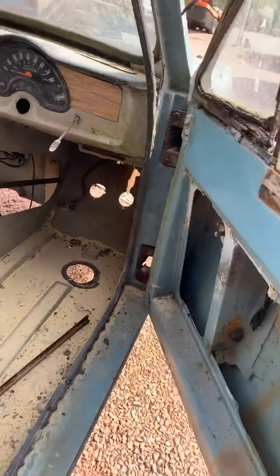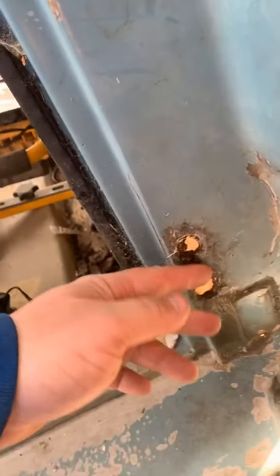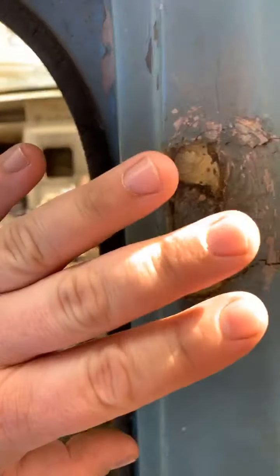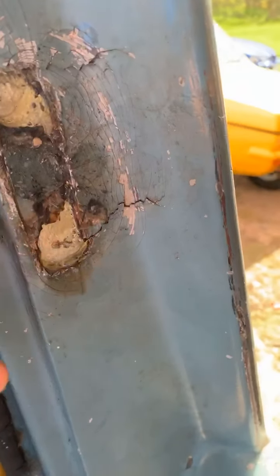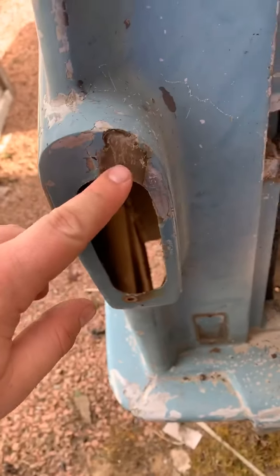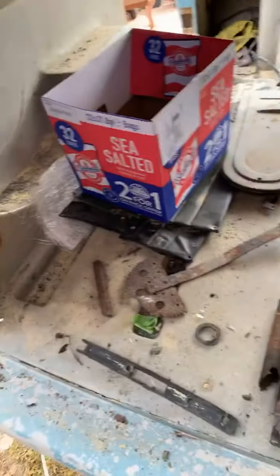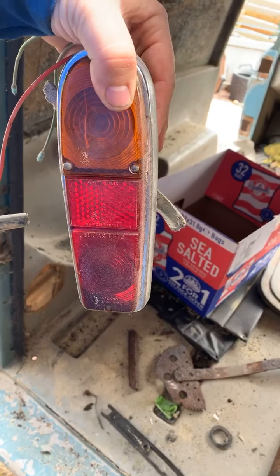The original speedometer was made for Reliant by AC, I believe, and I'm hoping it all works — I've not tested this one at all. Because of the hinges being completely rotten on the bottom, you have to close the door and lift it, but it's got a lovely note — I love the noise of these earlier Reliant doors closing. At the back, a common fault with the Supervan is that these get pulled out. On this one they've pulled the nuts out and actually snapped the bodywork. This has all been fibreglass repaired, and once it's sanded and prepped you'll never know it was broken. I'm putting a stainless steel plate in the back to reinforce it and give it the strength it needs.